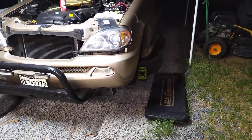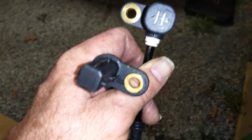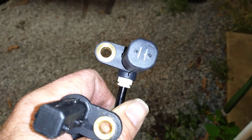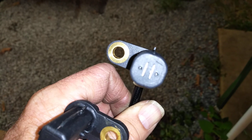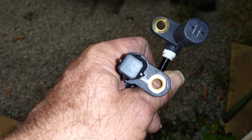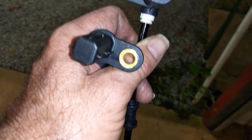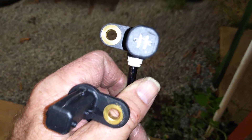This vehicle happens to be chassis 3-19-36-3, so I've been wondering what was wrong with my ML, and the fact is I installed the wrong sensors. The problem is they fit exactly — they're the same physical shape, the ends are all the same in terms of how they plug into the harness. So you could easily put in the wrong ones. The ones for the earlier ML series start with part number 163-540 for the numbers, and the later ones are a similar but not quite the same number: 163-542. You don't want to put those in an early ML. If yours is before chassis number A371935, make sure you got the early ones, not the late ones.